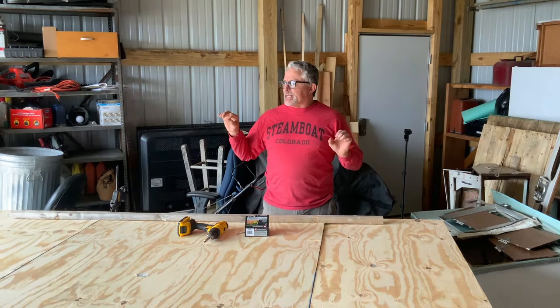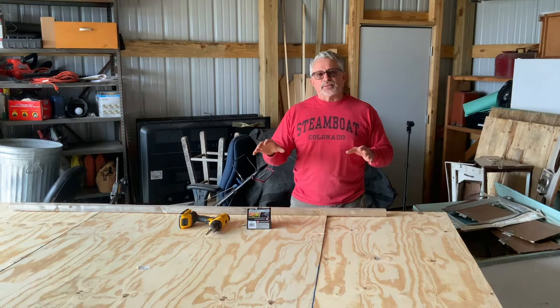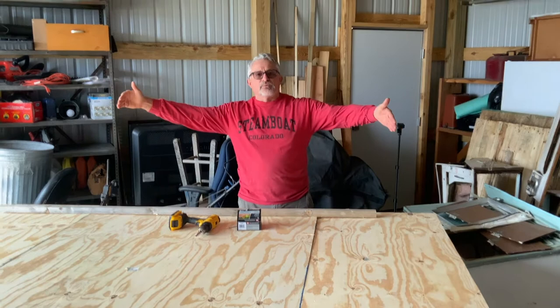Time to build the walls. I'm going to build them out of plywood, and the thing about making a template on this trailer is there was not any side — or part of a side — that was not rotted out. I've got a little trick for that which we'll get to in a bit. The bottom: it's a 10-foot trailer, but at the bottom it's only 9 feet 4 inches, and then it curves out on the front to give you 10 feet of living space.